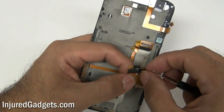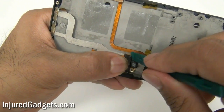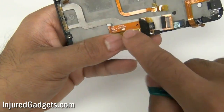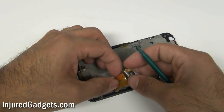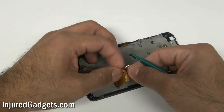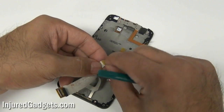Now, looking on the underside of this cable, you'll see a little piece of black tape — go ahead and remove it. There's also one of those yellow Kapton heat conductive tapes that sometimes holds two flex cables together — remove that as well. Be very careful with the black tape because there is a jawbone connector under it. This tape actually covers your LCD flex cable, which is held in by a jawbone connector as shown right here. Go ahead and disconnect that LCD flex cable and pop up that jawbone connector. If needed, remove that yellow Kapton tape since it's holding the two flex cables together.